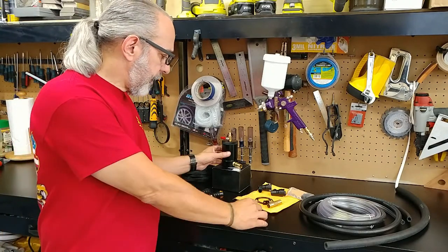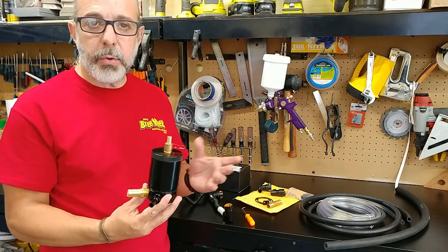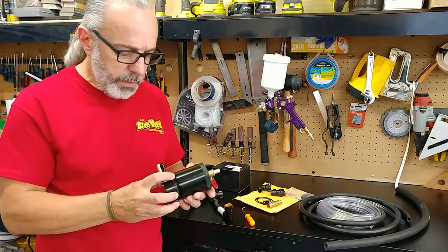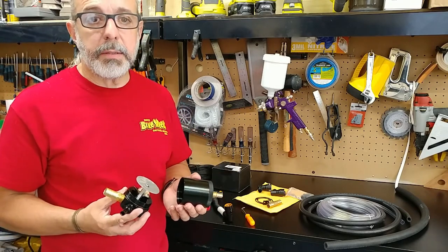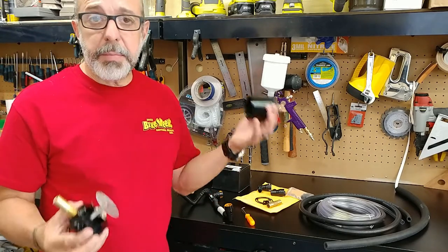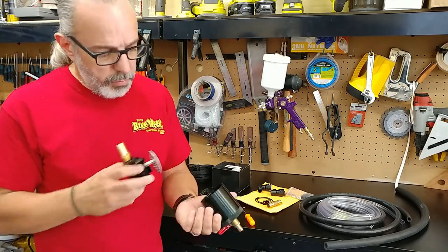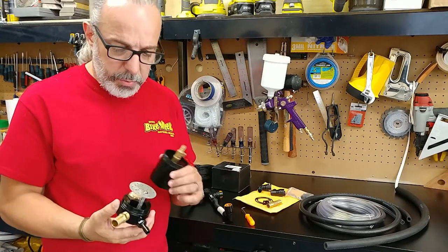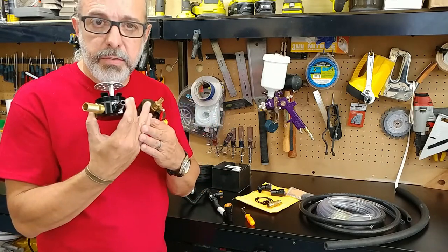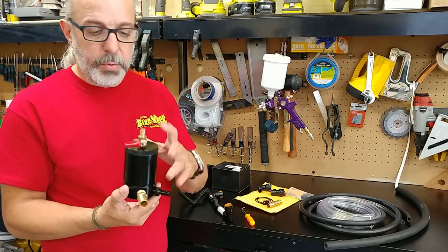With that said, a lot of people are going to have an issue with my catch can oil separator, and that is because this is a $15 unit from Amazon. It has been my experience that the only difference between a $15 one and a $150 one has been the pre-made hoses, which I don't need because I would be making a custom installation. This one is baffled. I will be adding some aluminum wiring there. What the wire does is when vapor touches the wire, it condenses quicker. It has a filter. Please make sure that it has a drain valve.